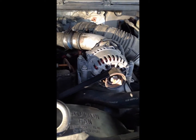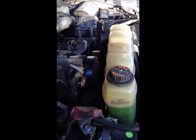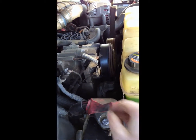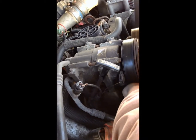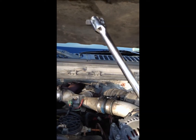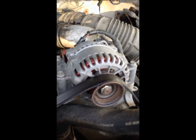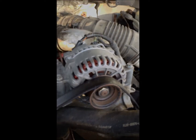This is a pretty simple task — take the alternator off. What you have to do is release the tension on that belt first. On this engine, the 7.3 turbo diesel, there's a small hole on this gray piece here which fits a half-inch wrench. What I did was grab the breaker bar — I love this thing, I've already broken three of them. Get it in the hole on that gray piece, crank it counter-clockwise, and you see it releases the tension on the belt. Reach in there, be careful not to pinch your fingers, and pull the belt off the pulley on the alternator.